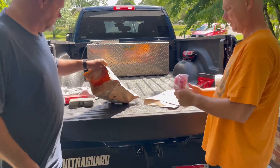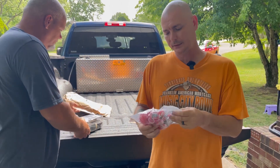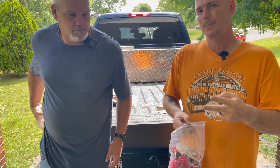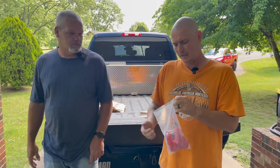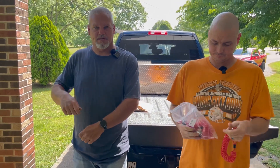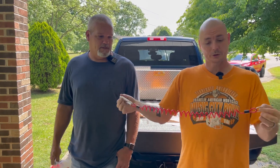So this right here — I got the idea from his videos — it's a bungee cord stretcher for breakaway cables. You can order a one, two, four, or six pack. I ordered a four-foot and they've been working good, but every now and again they can be a little tight. If the metal table on the trailer is a little too short and you turn too sharp, it'll pull out. So my thinking was to keep a full foot of slack in there all the time.